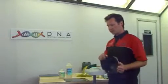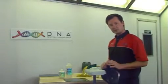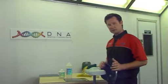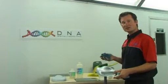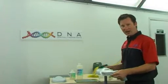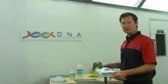Once you've sanded down your primer, you can apply the mutant crystals straight over that sanded surface. You can also apply any colour base coat you like. Once you've scuffed the surface, just use a clean cloth and some clean water to remove the excess off that surface. Degreasing solvents can actually harm the base coat, so try and avoid it.